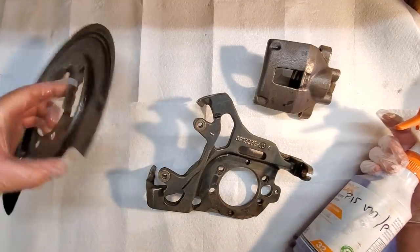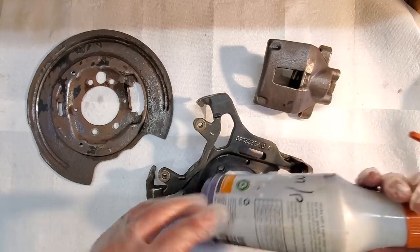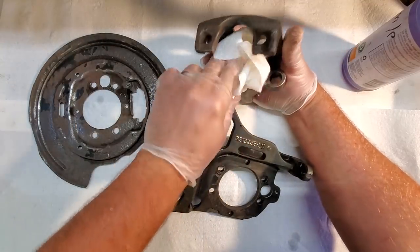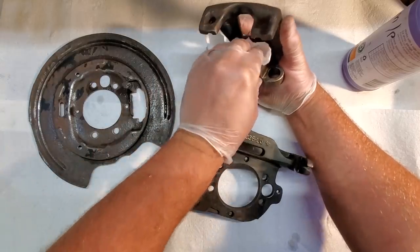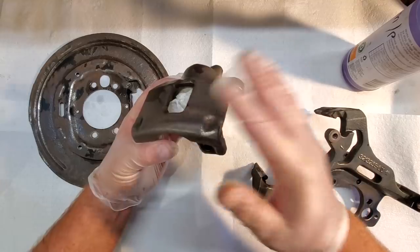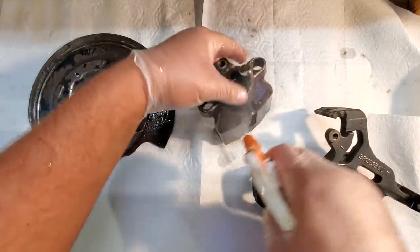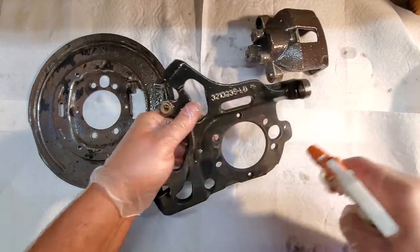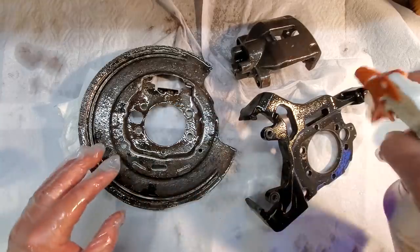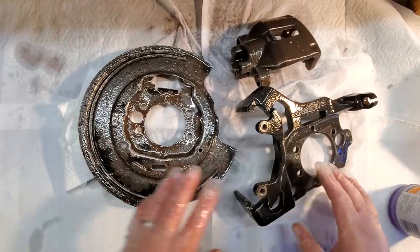All right, we got our parts nice and dry. Now we're going to hit them with POR-15 metal prep — this is a metal etching prep spray, mixed 50/50 with water. I don't want to etch the inside of the brake caliper so I'll stuff it to protect the inside. From here on out I'm wearing gloves — I don't want to get finger grease on the parts because we are POR-15-ing these bad boys using high-temperature caliper POR-15. Get this nice and saturated, and let it sit for half an hour.